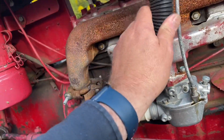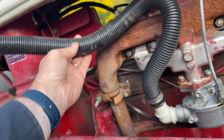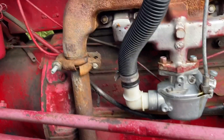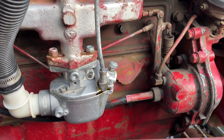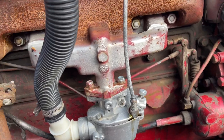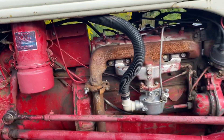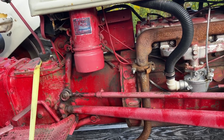There are a couple of things that need addressing — it's not quite 100% right. Looks like they had a new carburetor put on it not too long ago, and a nice steel line. It's sort of the two-end style here with the governor on the front — a two-arm governor. They can have two or three arms. It's also had an oil line put in it. This is of course a Ford 8N, one of my favorite tractors. From the serial number this turns out to be a 1951, so Boris with the V8 — which we need to do work on — is a 1952, just about one year different.